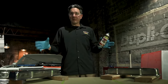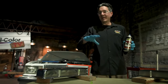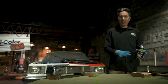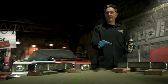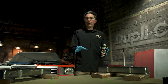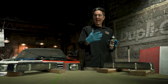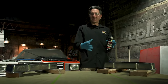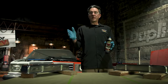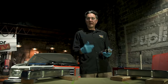We recommend three good heavy coats, consistent throughout, because the better the coverage is, the better and more consistently it's going to wrinkle throughout as well. I'm going to start with one very light coat just for that tack coat and then follow with three heavy, consistent coats. This paint does take some time to dry — approximately two hours to air dry — and that will allow the wrinkling to happen. To help enhance and speed up the wrinkling and help the consistency, besides good even coverage, we'll also be using a heat gun. So let me shake up this can a little bit more and lay down the first tack coat, followed by three heavy coats.